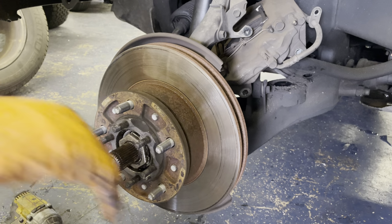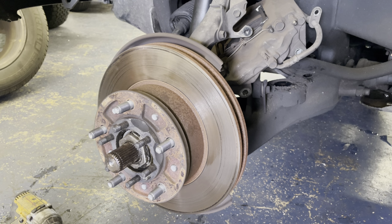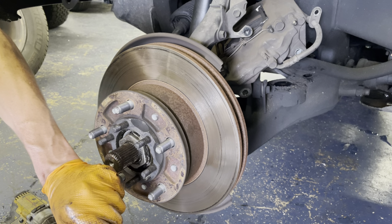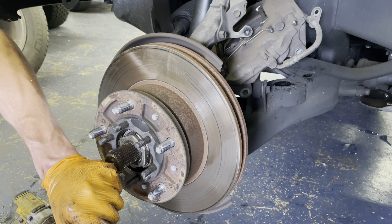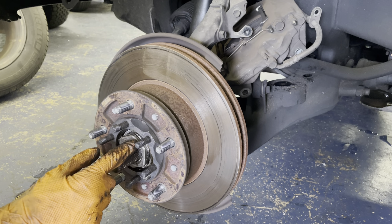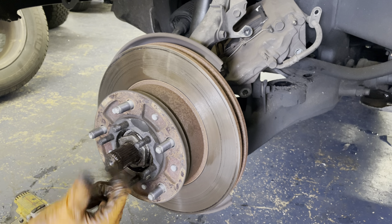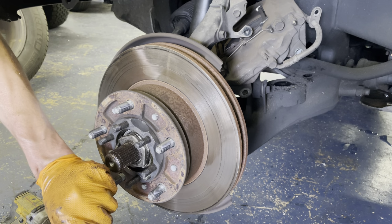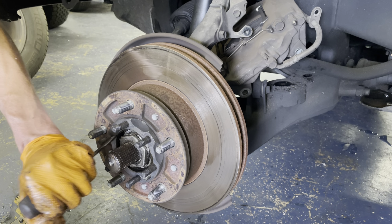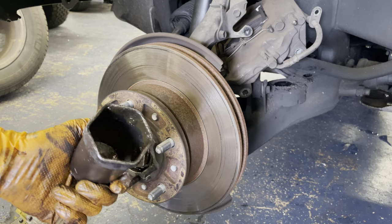There's a little bit. You know, a lot of times on 100 series it's super common to have the park to reverse or park to drive driveline clunk. So when you go and shift gears from a stop, you'll get that clunk. So you can see, look how loose all this stuff is moving. There's a 54 millimeter nut right here that you take out. And then there's a lock washer, like a 5-prong lock washer. You're supposed to bend a tab over this nut this way, and then over the other 54 millimeter nut on the back part of it. So I'm just bending the tab back, and you can see both nuts are moving, which is not good. So these were super loose. Next, 54 millimeter socket.